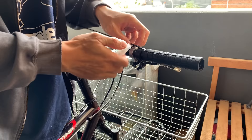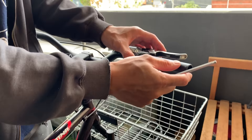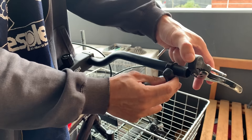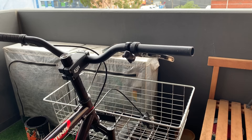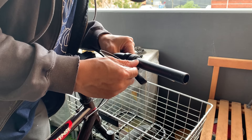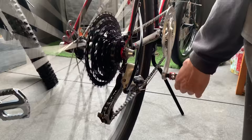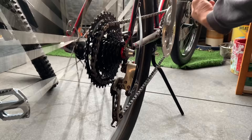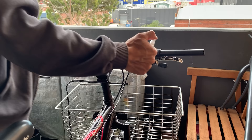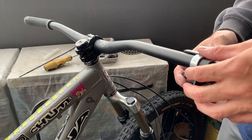This is my Cross Clydesdale cargo bike build. Right now it had the 9-speed shifter on there but I was running an 8-speed cassette, so it's a good excuse to change it out anyway. I can run a friction shifter on the bottom and it should work well with any cassette. You can see it works pretty good — it fits with this lever. Because this is friction and an old V-brake lever, it works. It goes through all the gears even the biggest one. So that's all ready. Just chucking the grip back on and giving it a quick clean.